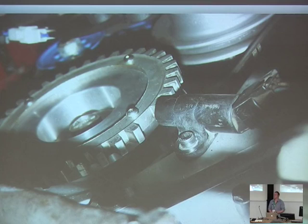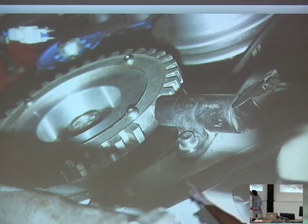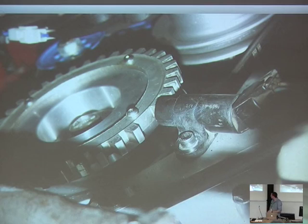This is an example of what's called a crank angle sensor — one kind of implementation called a missing tooth sensor. The sensor can be a Hall effect sensor, a variable reluctance sensor, or an optical sensor. This cog or wheel spins around at crank speed and gives you two pieces of information: every time you detect a tooth, you can tell how fast the engine is going and calculate RPM. You'll also note there is a missing tooth — that's very important because it also gives position information for the engine. You can detect when you've missed that tooth and then know where you are in the engine cycle.